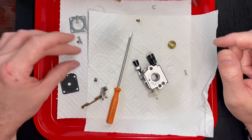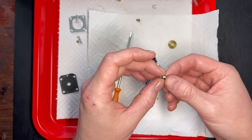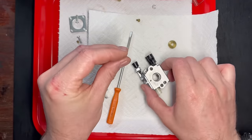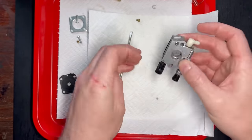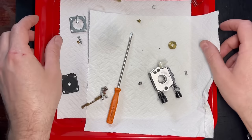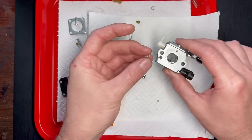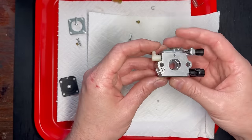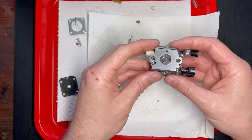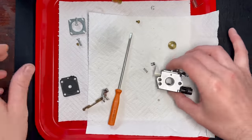I've just come back from the shop and I can't get the O-ring — it's a bit annoying, I have to buy it as a kit and it's like 15 bucks. In my opinion it's just not really worth it. So what I'm going to do is show you how to seal off the accelerator pump so you don't have to worry about replacing it. We need to pop this plunger back in with a small portion of the spring — not the whole thing, just a small portion — and then seal it with a bit of nail varnish. Let me just do a quick drawing of what's actually going on.